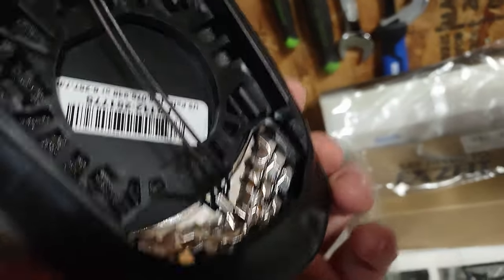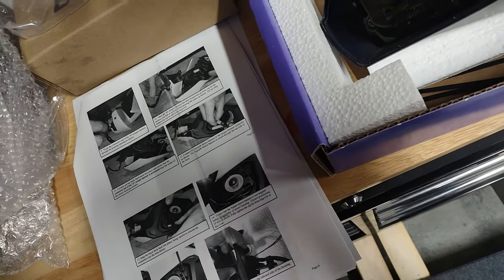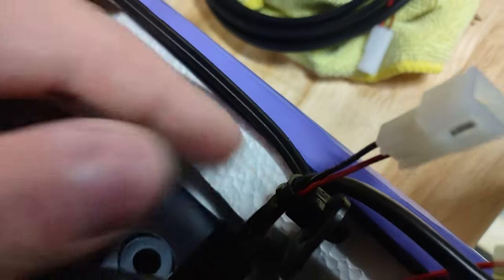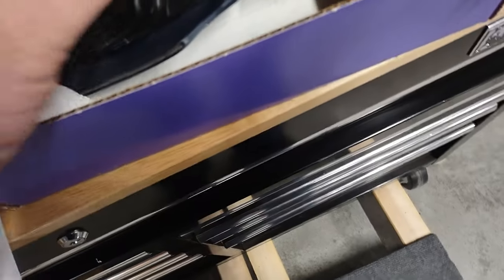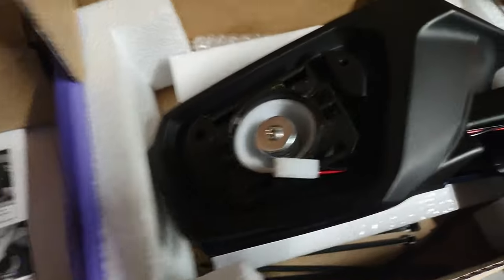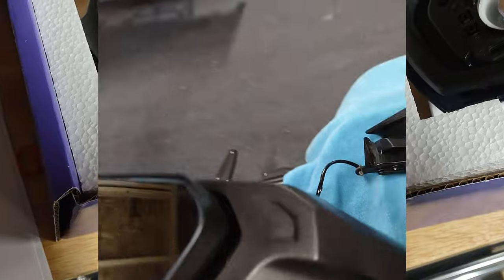The mirror is going to sit just like this, but you have to put the face plate back on first. Since I'm doing two steps, you can zip tie the new wire to the wire that's already coming out — but because I replaced the feed line, I just ran it through the same line without a zip tie. Make sure it's going to be long enough to feed up through the face plate. Don't put the face plate on all the way yet — get it close, plug the connector in, make sure everything is up underneath, then put the face plate back on.